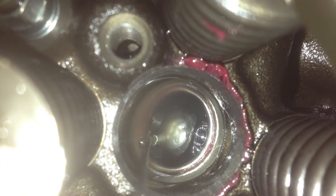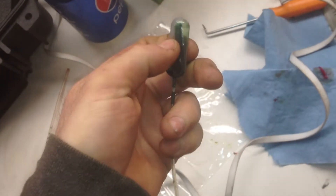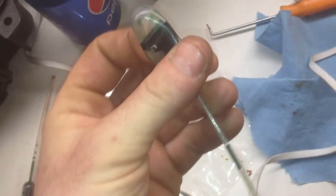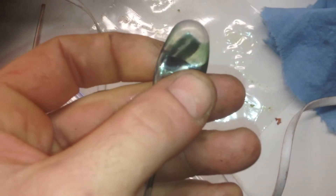I don't know guys, looks good. Just watching for any bubbles. I think it's good. Now the issue is, hopefully we cleaned the injector bore good enough. Because if any of this is outside of the bore when we go to put that O-ring in, the fuel will not seal. There's a little bitty piece — I just broke it. I bent it halfway and it broke. It turns into like really hard plastic.